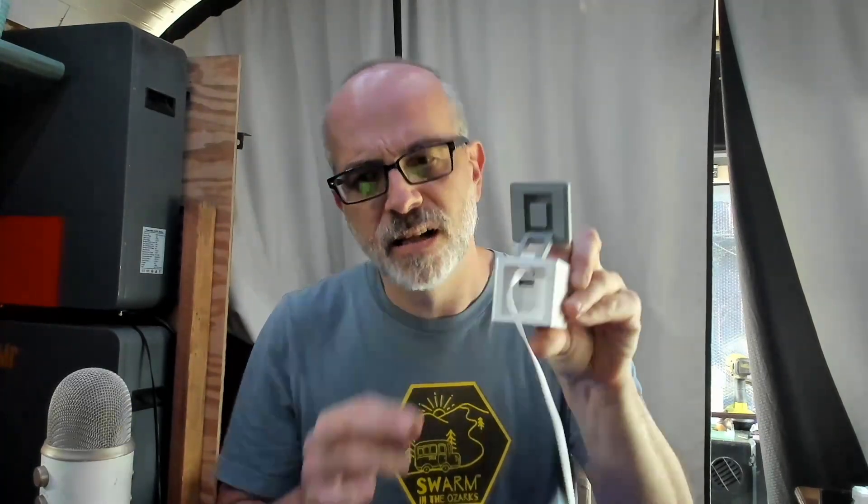And it is an actual six and a half minutes — not exaggerating. Plug her in while holding the button. You'll see orange, orange, orange, then blue — then let go. During this process the light will change a few times and there will be a couple of audible clicks. It's been about 50 seconds and I just heard the first click — that's the camera initializing its first boot, with WZ Mini Hack starting up for the first time. In a few seconds it's going to start reprogramming the flash.